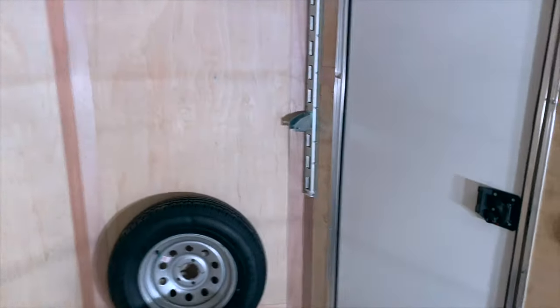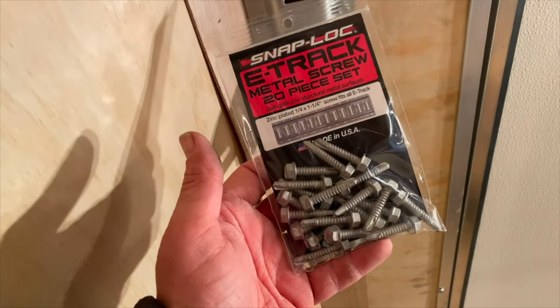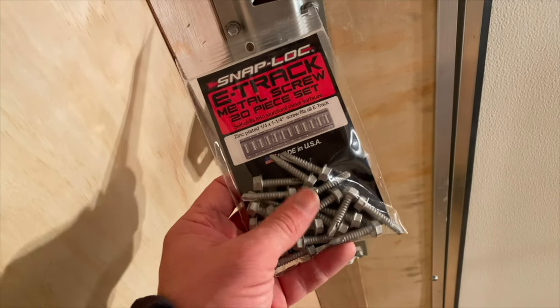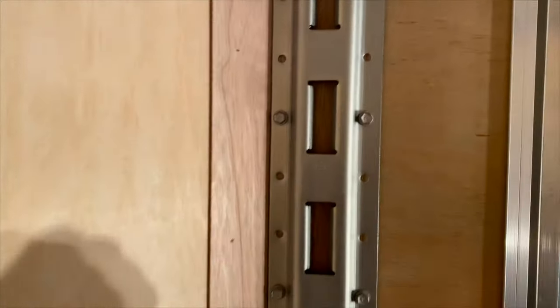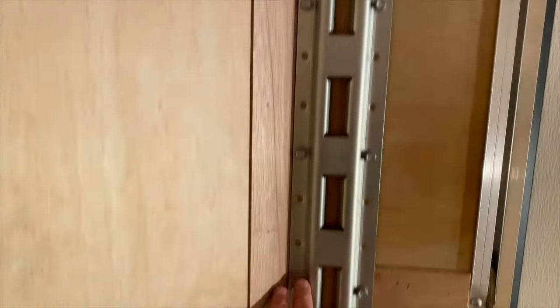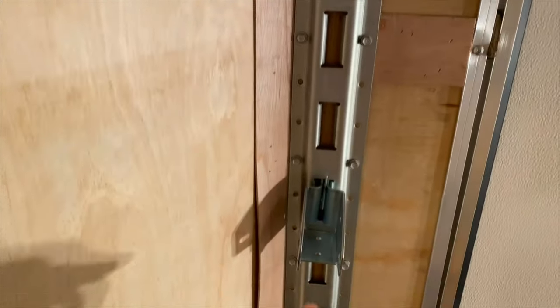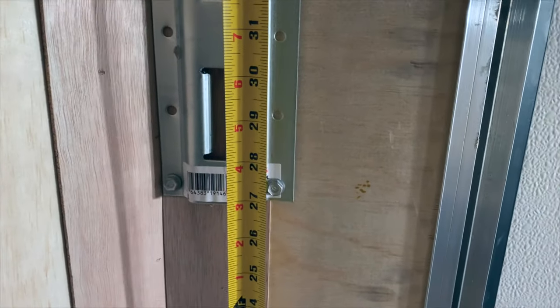Back up a little bit to see what it is we're doing — it's going to go over to the other side. This is what I'm using to screw in the e-track: a zinc-plated quarter-by-one-and-a-half quarter-inch self-drilling screw. Just make sure that you find the frame, because everywhere that you drill in may not have a frame. Right along here is where the frame is. This one isn't into the frame, but with more bolts added every second hole while skipping two, this should give it plenty of strength.